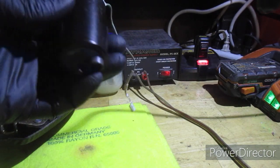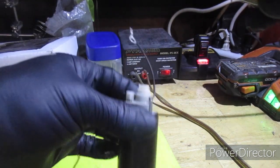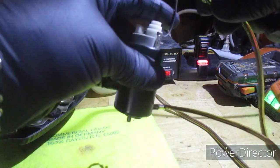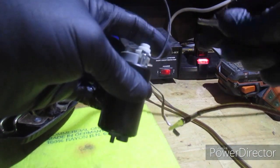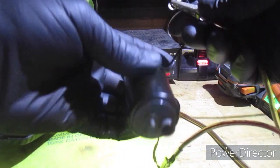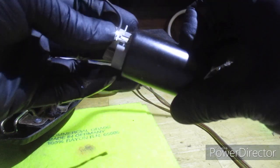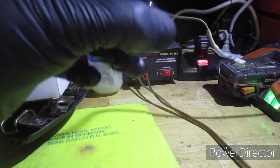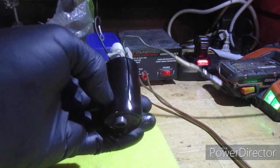This one I got from All Balls — they're pretty good. I've actually been buying stuff from them for a while. It feels like it's got torque and it sounds good. That sounds really good and you can see it getting fuel out. So like I said, always bench test these pumps. Sometimes they might seem a little off — sometimes they might be locked up, bearings wore out. Always check before installing.